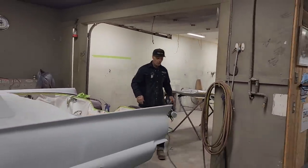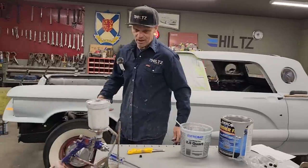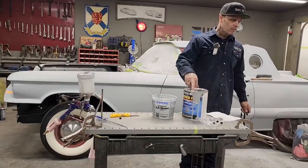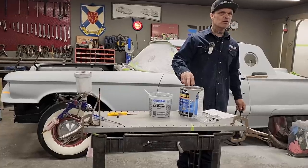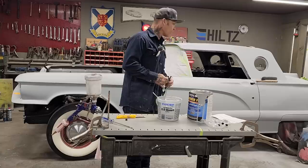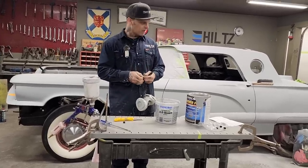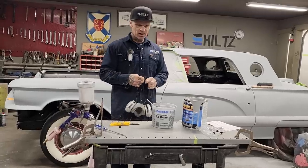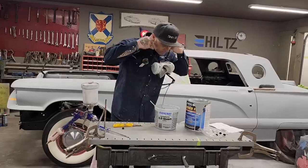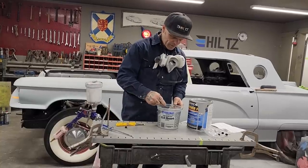Epoxy, the word, is used a lot. Everybody likes to epoxy their metal. I like to skip that because the primer's 250, and your epoxy is another 250. I like to leave that out of the equation, and the reason is I'm getting the same results without it. It does not do anything for me other than take my money. That's all it does for me. But if you feel like you have to, that's what you got to do. You do what makes you happy.